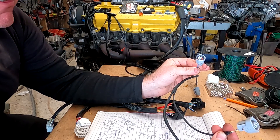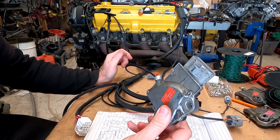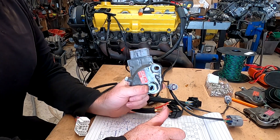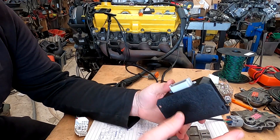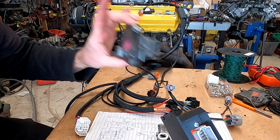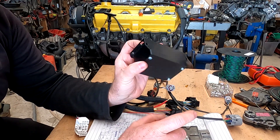I've also put the two speed sensors on — that's the rear speed sensor and the NCO, the overdrive speed sensor. I have wired up the shift inhibit switch too, and that is going to Scott from Next Level Motorsports' little twiddly box — that is the technical term, guys. It's a signal modifier box. It takes the digital signals from the gear selector, gear indicator switch, or inhibit combo switch, and sends it as a single analog voltage into the ECU.